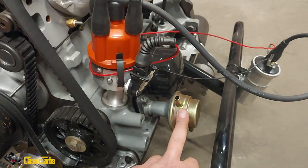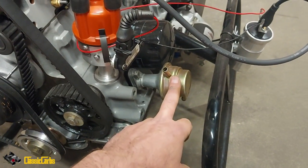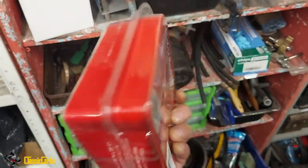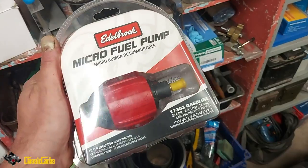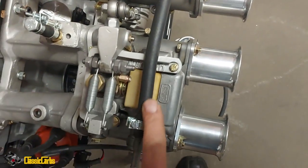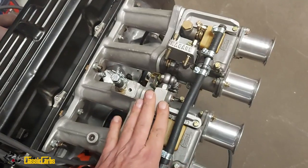We were running the standard fuel pump, but it's a Pierburg Ford one, and it's too much fuel pressure, so we are getting a few drips off the carbs. So I'll need to change that, possibly for this, which is a... You can go for all sorts of pumps, but... my nail is bust. Sorry, that's ugly. It's just a 12-volt low-pressure electric fuel pump with 8mm unions for 8mm fuel hoses, which is what these carburettors take, 8mm inside diameter. It's got a period classic twin cable throttle linkage supplied by Roy.